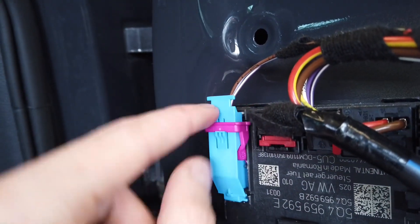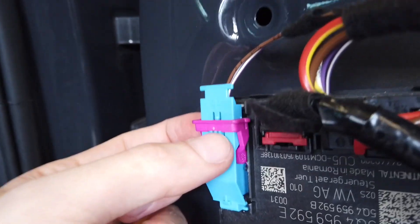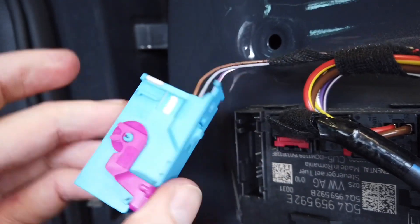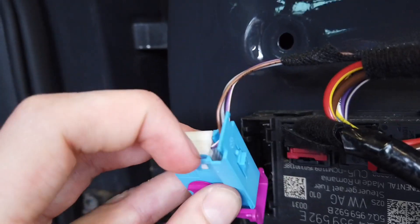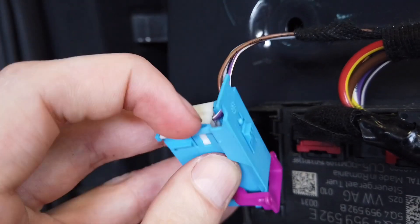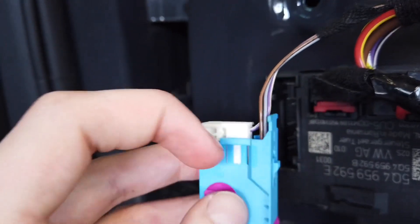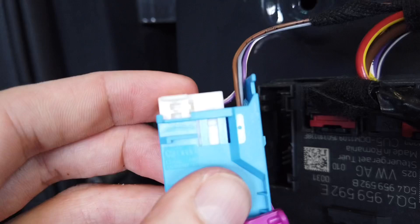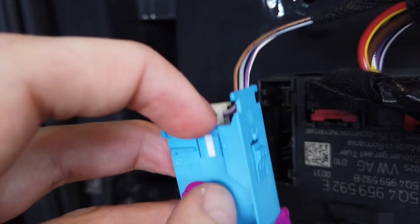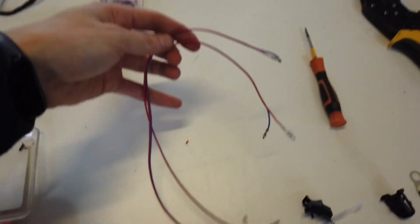There was a zip tie here holding those three wires. To release the blue 32-pin connector, press here and move the purple one. To add wires, gently pry the blue lock, then move the white insert — there are two steps to this lock, so it will first come out about two pins and you need to do it again to remove it altogether.